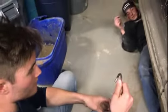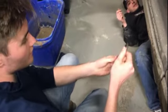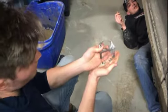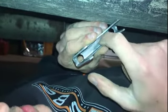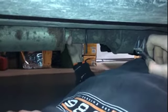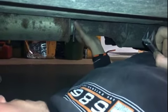So this is one of the new clamps. What Colton's going to do is put this on top where the muffler meets the pipe that's already on the car. Put this on top, put this on the bottom, put two bolts and tighten it down. What I like to do is put one on one side of the pipe where it comes on to this other pipe, and then one on the pipe we're putting it onto. That way it pulls them together to get a good crease.